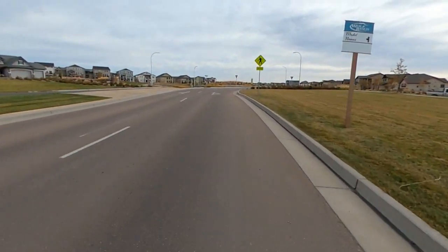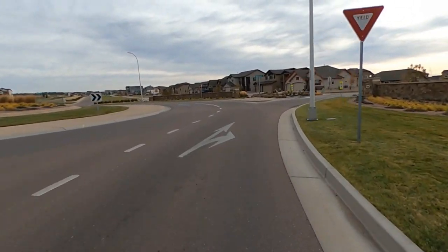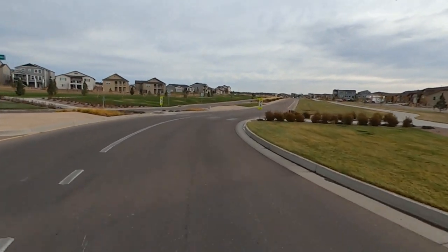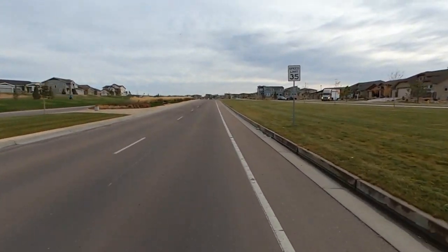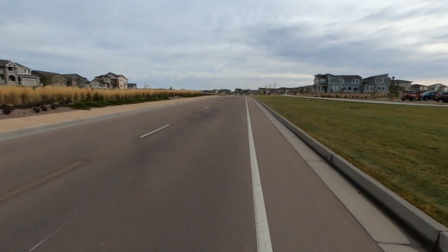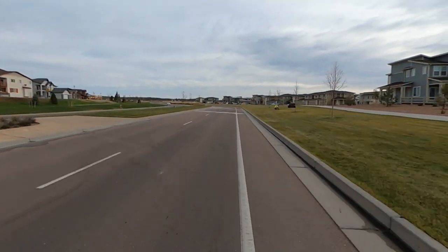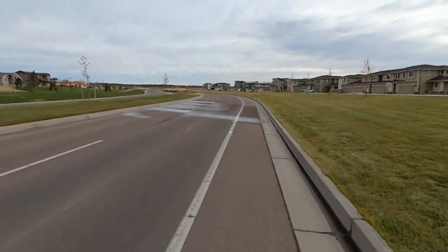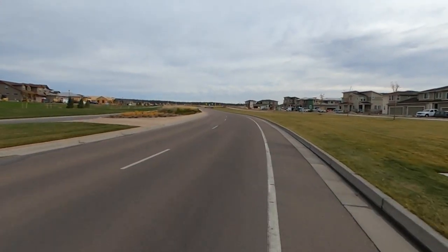Just hit about 50 percent battery and I'm at 13.8 miles — almost 14 miles at 50 percent, that's pretty good. With the rubber wheels, just like on the Onza, these do not coast downhill very well at all. There's a lot of resistance on these rubber wheels and that's what kills the range. The heavier you are the more amplified it is — with rubber wheels it's even more pronounced. But 14 miles at 50 percent, that ain't too bad. There is also a little bit of bearing chatter in what seems to be the pulleys — this is running metal pulleys and you do get a little bearing chatter inside them.